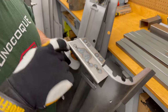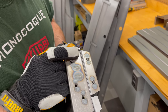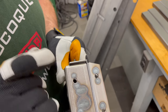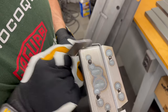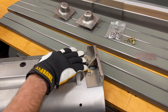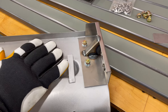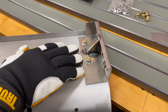When you put them on there, we're going to put the floors on top here. Some people put them on bottom - that is incorrect. You want to put the sill underneath the floor. So you've got an 18 gauge floor coming in here. These inner sills already have two holes in them, and the engine frame brackets will also have holes. It wasn't that way originally from the factory, but it comes that way now, and we make our engine frame brackets that way.